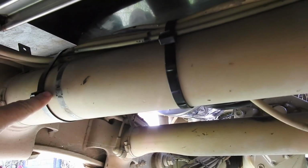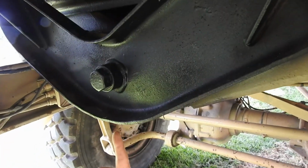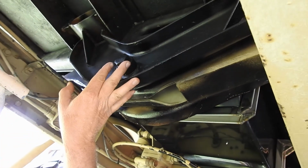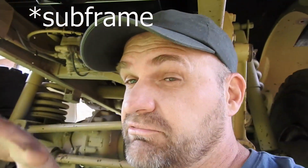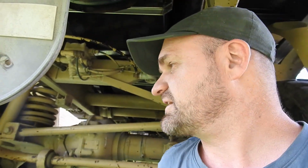And these are the torsion tubes that join the two sides of the chassis together to enable it to twist. So to allow for that twist, these trucks come with an articulated tray on these articulated mounts here. So a lot of RV manufacturers that manufacture Unimog style camper vans, they get rid of these articulated points on the rear section, and they mount their box mounts directly to the chassis rail. Their box mounts do have a bit of flex, but that inhibits a lot of the twist the chassis will get and inhibits the off-road capability.